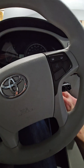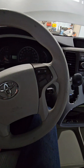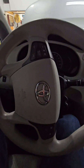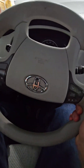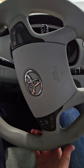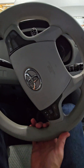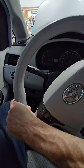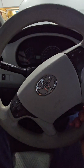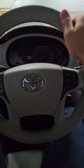I'm going to try to reproduce this noise - it's a heavy-duty clunk. I've got the car jacked up in the garage and I'm not going to turn it on because it'll still make the same noise. Oh god, it feels a lot harder to turn. There it is - a huge boom, a bonk, a clunk noise. When it's cold it's worse, and the car doesn't even have to be on. You don't have to be moving - just turning the wheel makes a huge boom clunk noise.